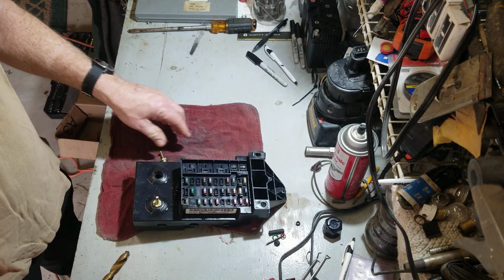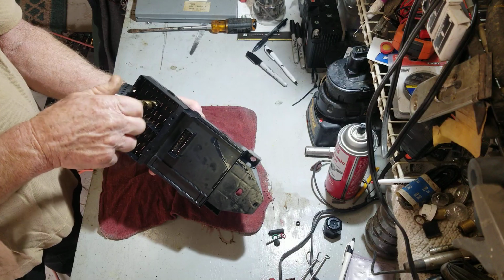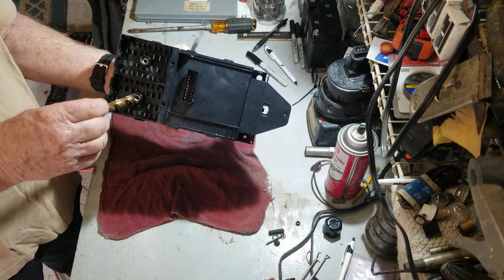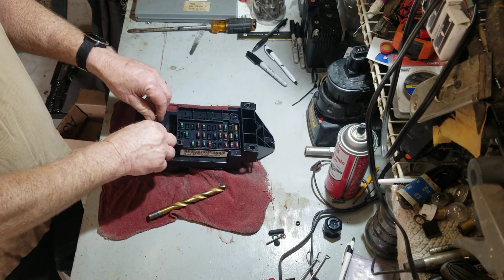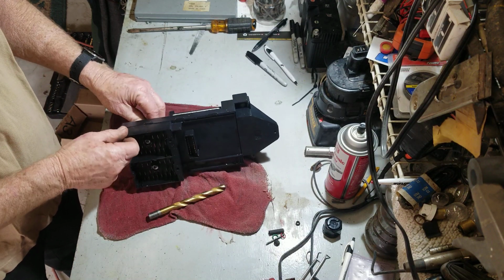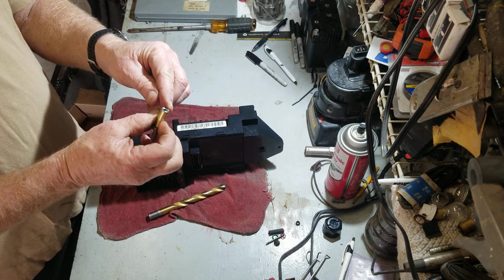These I got out already by using a drill. I used a half inch drill to drill this out just down to the threads, and then I cleaned them up on a grinder. Once I got there, I threaded an extra screw in there and pounded them with a hammer, and then I hit them with the grinder so they'd go back in smooth and easy too.